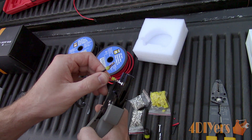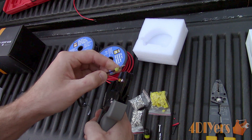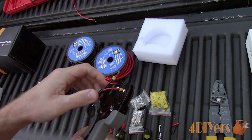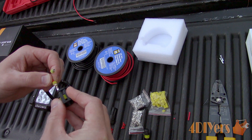But they do need a special crimper to install the terminals. Install the terminals and pinch them in place by hand, then use the terminal crimpers for the connection. Once done, install the connector casing and retaining clip.